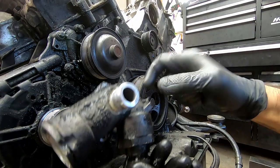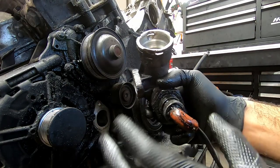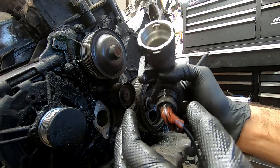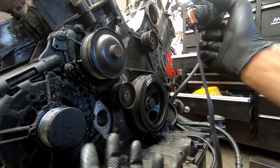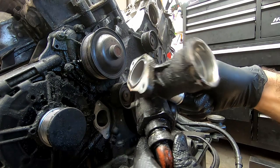This little flange here is actually equipped with a block heater, which is not indicated anywhere. In my case there was no cable — just a little cap sitting on top of it. So I thought I was going to have to get a block heater to make winter starting a little bit easier. Turns out you just have to get yourself a cable and hook it right into that.